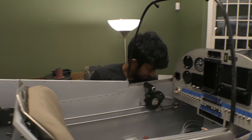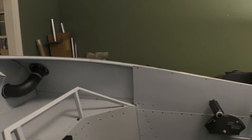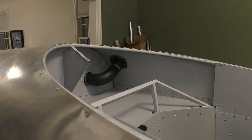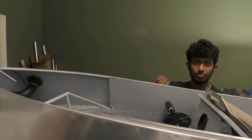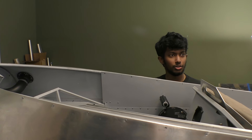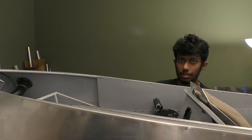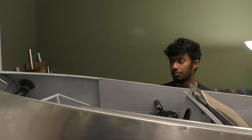There's another thing that we had to do and that had to do with the fill line here on the tank. When we started, we had a right angle — sort of like a PVC 90-degree angle — which we thought wasn't good for filling fuel because of all the backsplash. So we decided to put a radiator rubber hose kind of thing, a nice smooth sweeping 90-degree angle, which is better for pumping fuel.